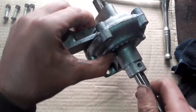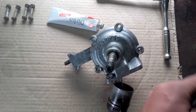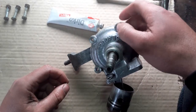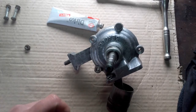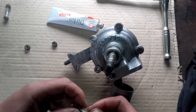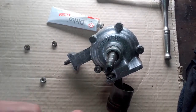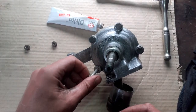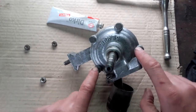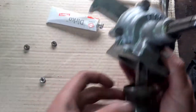So there we have the two together - it spins quite easily there. I need a little bit of two-stroke oil on the crankshaft to help seal the bushes as well, so I will just drop in the four studs. These are studded from the top - this is the upper crankcase where your flywheel is going to go on. Put the stud in at the top, just slide it in all the way and we can tighten the nuts from underneath. This is actually off of a Featherweight, but the 40 plus will also only have four on this - just a smaller one, 64cc piston.